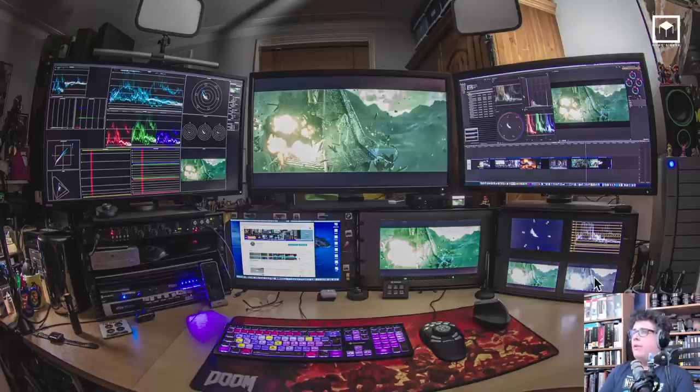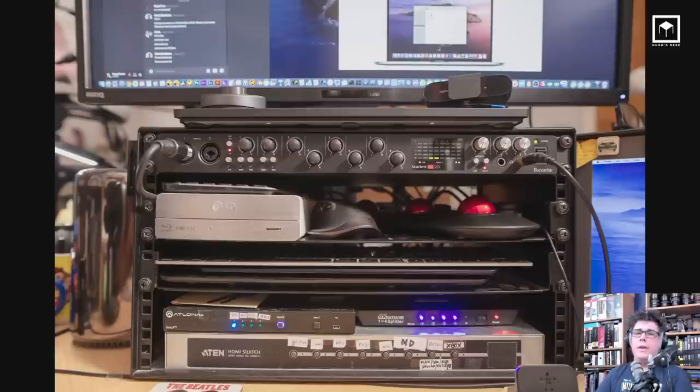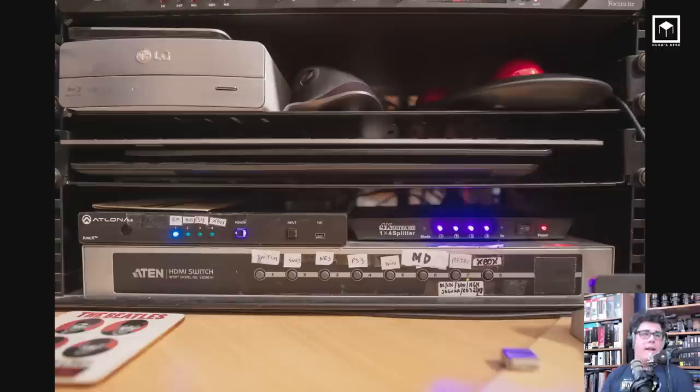They all run — because I like to be very efficient — three desktops: one is a video preview in the middle, then desktop on one side, another desktop on the other, and another video preview. I like to swap them around depending on my task, so to do that I need three switches. Very important: when you run switches, you need to make sure they are really high quality — you want switches that can run 4:4:4 full quality, 4:4:4 uncompressed signal at 60Hz, because a lot of switches out there are only 4:2:2, not 4:4:4.